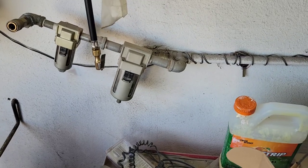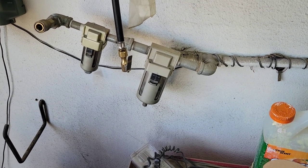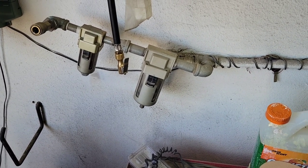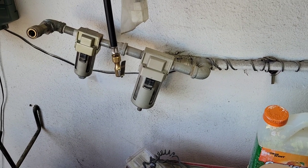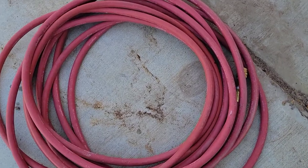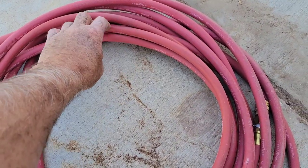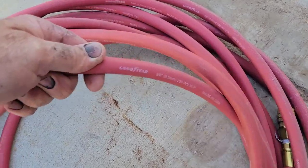Keeping water out of the air is a really important thing. It helps keep your fish eyes down and also keeps those big giant water splatters from coming out of the gun randomly — nothing you want. It's a pretty nice good hose you know; you want to have one that you use just for your spraying.